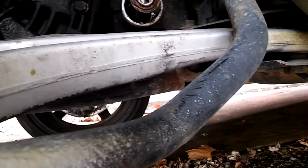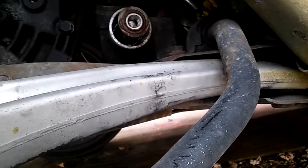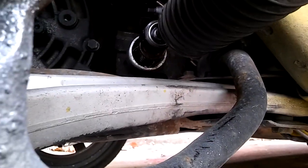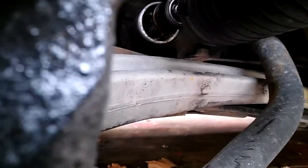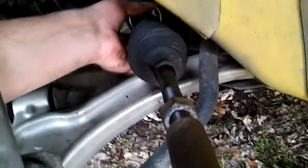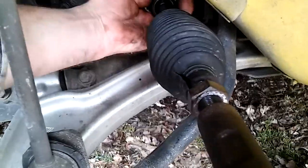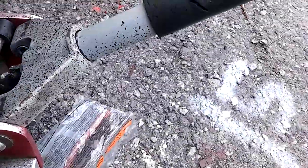We're going into the rack and pinion — slide the boot over to the big housing on the rack and pinion. Thread it on by hand. The tie rod outer end is moving around so I need to double-check my count on how many times I turned it, but I spray painted the mark on the ground. The nut is where the other nut was — it's called a jam nut. They gave a new one; I just had to take it off and put it back on.